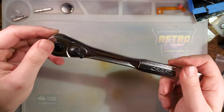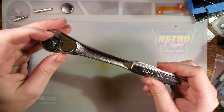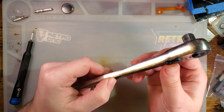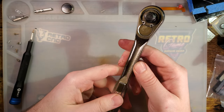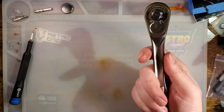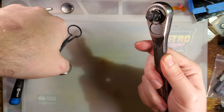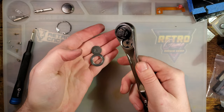For those looking at the wrench in my hand, and for those that know exactly what I'm talking about, you probably know exactly what I did. If you don't have the leverage with the tool you're using, it's not the right tool. Long story short, I got the right socket on there, put the wrench on, didn't quite have the leverage, so I stood on the tool. Well, the bolt did not move, but the wrench did, and I killed the wrench. We did end up getting the bolts off later with another wrench that my stepfather happened to have on hand, but a breaker bar would have been the proper tool of choice. Anyway, let's do an autopsy — that's all I wanted to do here.